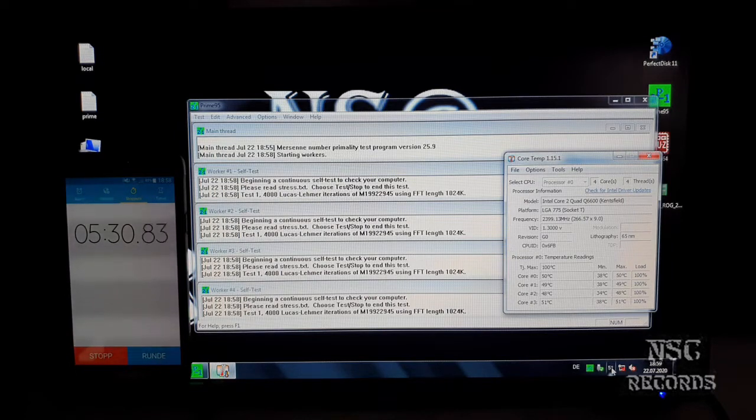on my PlayStation 4. Thermal Grizzly Kryonaut is really not bad, but I can feel sometimes that this thermal paste needs really a lot of pressure. And a console, it doesn't matter if it's a PlayStation 3, PlayStation 4 or a PlayStation 5 or Xbox 360 or Xbox One and Xbox X or whatever. It just doesn't matter, because I just want to explain you one thing, guys. Important for these thermal pastes and for the cooling is the pressure, okay? Without enough pressure, you're not gonna have a great cooling, because the cooler has just not enough contact to the CPU.